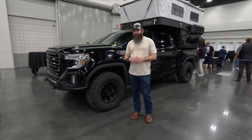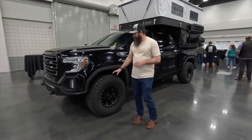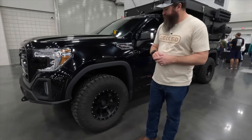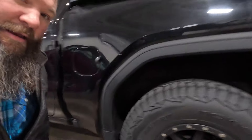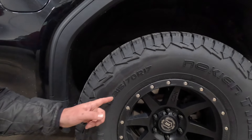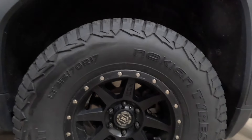I mentioned earlier that I wanted to go with that bumper simply so I could get bigger tires on there and have a little more ground clearance up front. I went with these 315/70s — these are Ridge Grapplers. I've been happy with these so far, but I was looking into some Nokians. Since I filmed that walkthrough video, I actually swapped out the tires from the Nitos to these Nokians. These are the Outpost NAT — the NAT is kind of the update on the Outpost AT. They're still 315/70 R17s, which are a little over 34 inches tall and right at 12 and a half inches wide. Same exact size as what I had. The Ridge Grapplers are a hybrid tire — kind of part mud terrain and part all terrain — so not as aggressive as a mud terrain but more aggressive than an all terrain. The Nokians are an all terrain, so a little quieter on the road — I noticed that already.